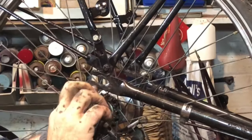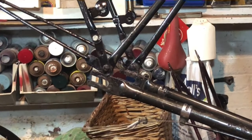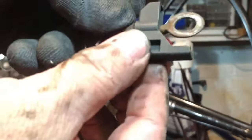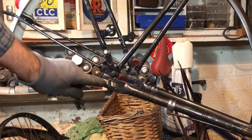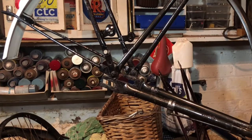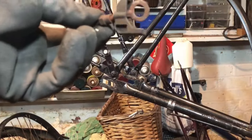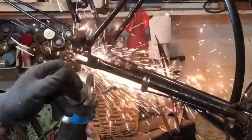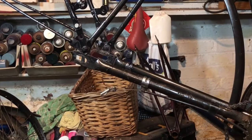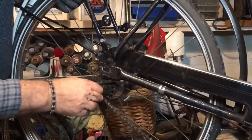I can see why Gazelle chopped off the back centimeter of the bottom slot here, and they created some special offset chain tensioners. I'm wondering if I might modify this one - I'm sure I've got some Gazelle offset chain tensioners. If I have, I'm going to do a little modification. I've got one - see, this is the thing. So with some lopped off the bottom of there, that just takes the place of a normal one and gives you a bit of extra room to get your wheel in. I found another one - all right, everything gathered together that I need.